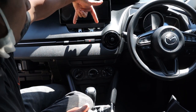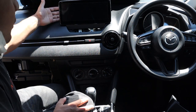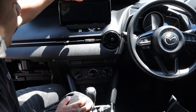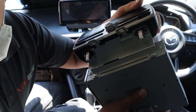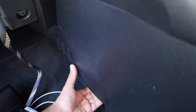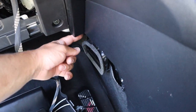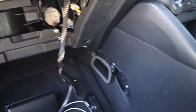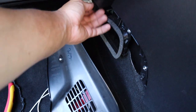When mounting this, you've got two little feet that click into the dash and 10mm screws. Underneath the chassis there's a metal plate and the radio body needs to sit on that - make sure there's no wiring underneath it otherwise the screen will sit forward and won't sit nice. We're going to use the clips from the original radio. You can remove this side panel - it just pulls off - then run the wiring up behind here and snake or tuck your hand up to get it right into there. When you pull it through it'll pull itself up into the middle of the panel.